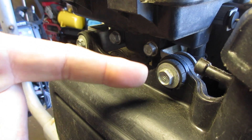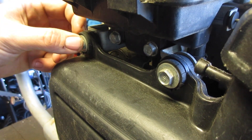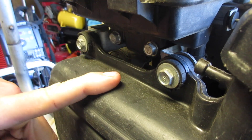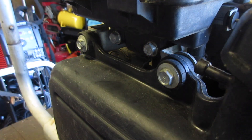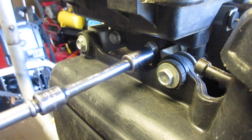These do not take the carb out — these are just little bushings or buffers for the reduction of shaking for the tank. Now if you need to take the tank off, you definitely need to take those off. I think there's also one or two on the bottom. But to take the carb off, it's actually these bolts here.